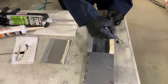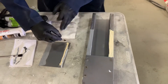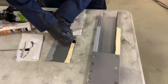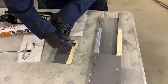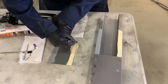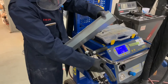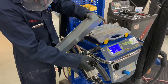However, weld sealing doesn't add as much strength, so manufacturers may choose to use this procedure in certain areas of the vehicle where they do not want excessive amounts of strength built up — these could be weaker areas that they do want to fail in a collision, so these may be used in areas where the manufacturer wants more energy to be absorbed by the panel. In any case, always follow OEM procedures and guidelines for the adhesive you're using.